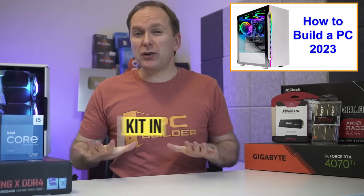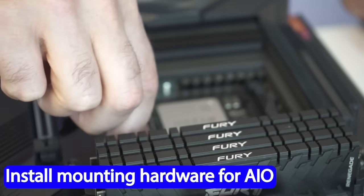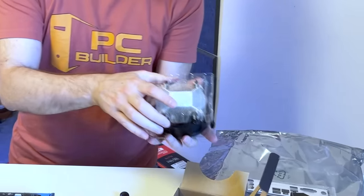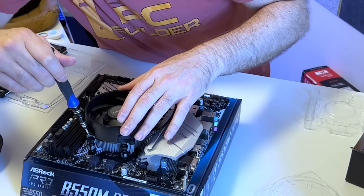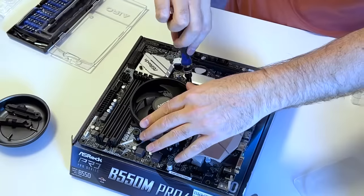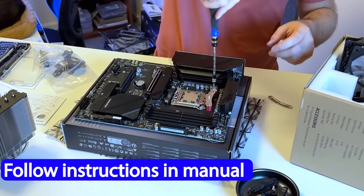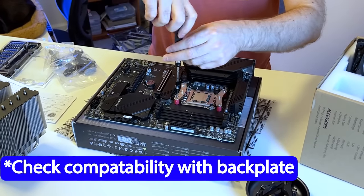Step three is installing the cooler. Make sure you're using the correct mounting instructions and kit if using an aftermarket cooler. If you're using an all-in-one liquid cooler, you can install the pump now, but I generally prefer to get the mounting hardware installed and put the pump on after it's in the case so we can angle the tubes how we like. For the Ryzen box cooler, unscrew the plastic retention bars and remove them. The CPU cooler, which has thermal paste pre-applied, just goes right over the top and into the screw holes. Seat each screw hole first, then apply a turn on each screw in a crosswise pattern to ensure equal mounting pressure, continuing until snug — don't over-tighten, as that can damage the CPU. For AM5 compatibility, see our 7600X build guide.